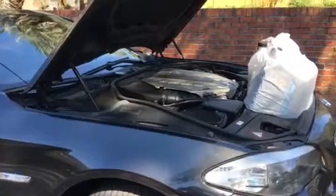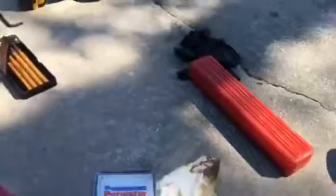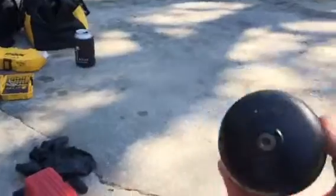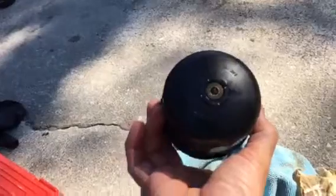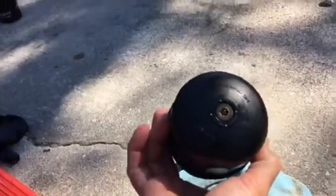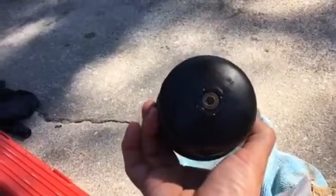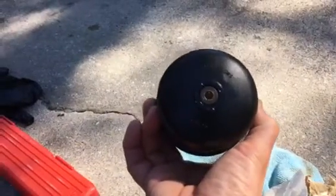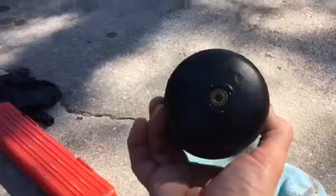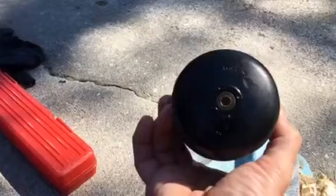The oil filter has a filter housing that has sort of hex-sided shapes on it, and it does have a socket in the end. The one on mine had been, and I bought this with 97,000 miles on it, but it's 87,000. It has a socket in the end, larger than 6 millimeters but smaller than 7 millimeters, and I ended up having to adapt a hex to fit in.